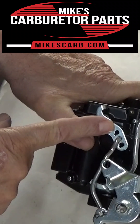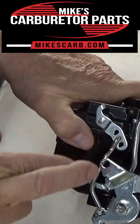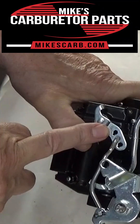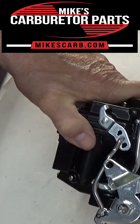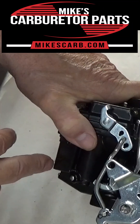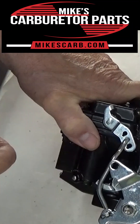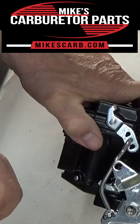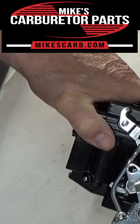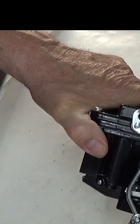Why they put it in the center hole, I don't know — you can try it that way. If yours is on this hole, that's where I would leave it. You may be able to correct your bogging problem with this three-hole lever, provided the bogging is caused by the carburetor. That pretty much covers it — that explains your pump lever and any adjustment you might want to try. Thank you for watching.